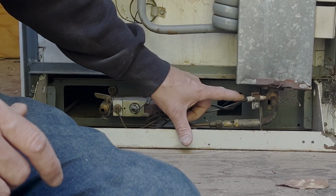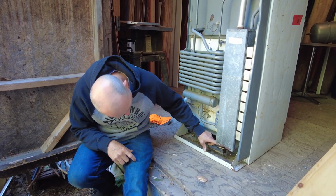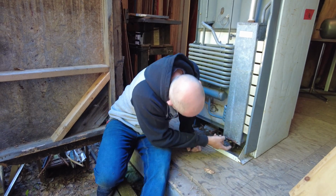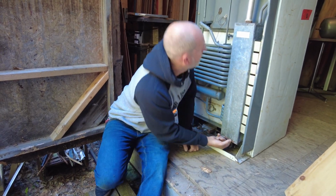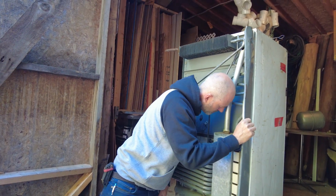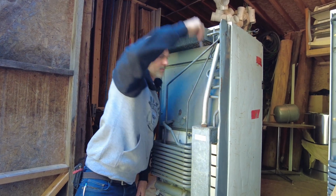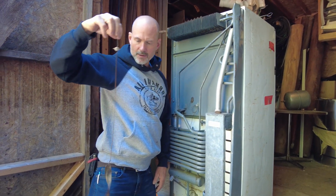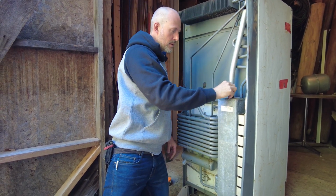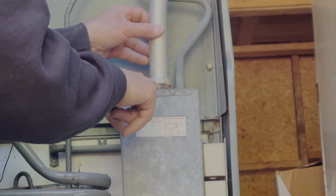And when you look at this burner mechanism, you see the thermocouple probe has to stay inside of the flame. Looking at this, this actually has one of those gizmos right in there already. Look at that. So that was just buried down there, just fell down. So this guy should hang at the top. The wire needs to hang over the top, just like that. This guy needs to go over just like that.